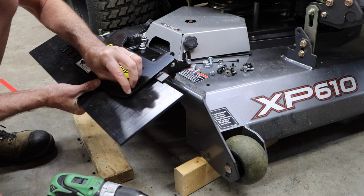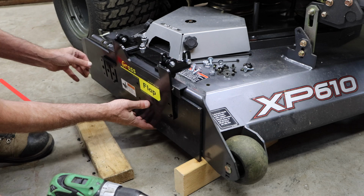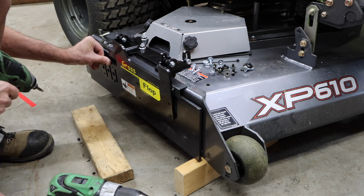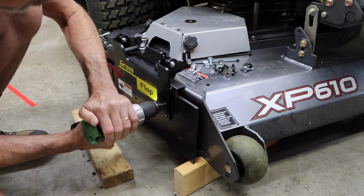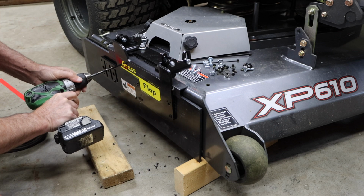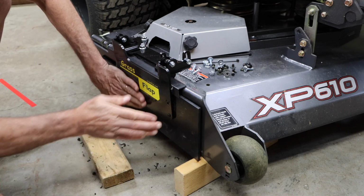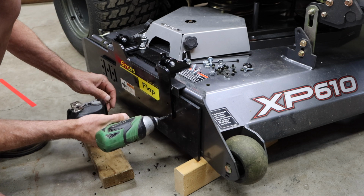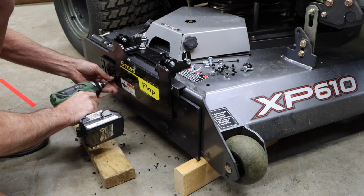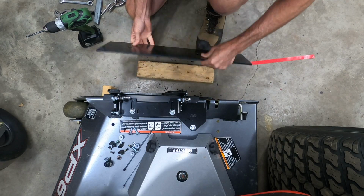So we'll go ahead and run the screws in for those first 2 pilot holes that we drilled. Now once that's done, we'll go ahead and drill the remaining 6 holes that we have to install T-nuts in. With the additional 6 holes drilled, we'll remove the plastic blocker plate again, put it on the 2x4 block, and finish installing the remaining 6 T-nuts.